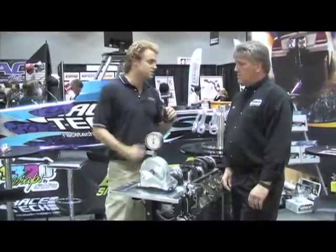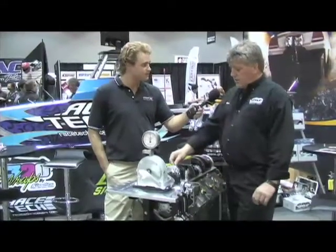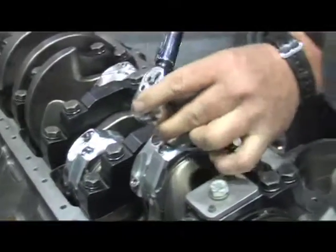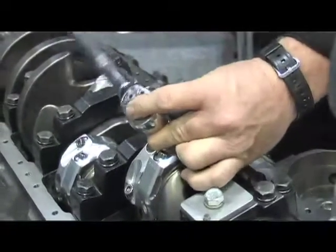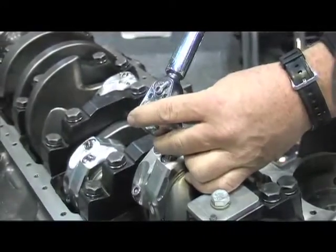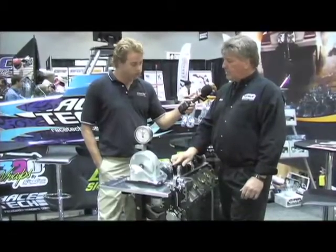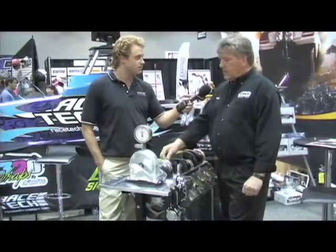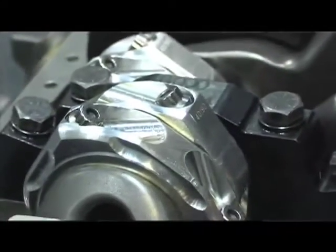That's what we need to keep this motor together. And if it's not tightened down enough, what are some of the risks involved? Under-torquing is actually, in a lot of cases, worse than over-torquing. The under-torquing will actually cause movement — when the tension load is greater than the clamp load, it'll actually cause movement, and it'll fatigue the threads in the rod and possibly pull out. How much pressure are we looking at at redline? On a motor like this at eight thousand RPM, I believe the number's right at twenty-two thousand pounds tension load.